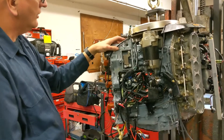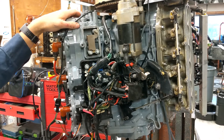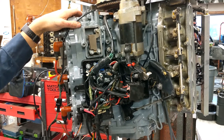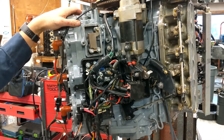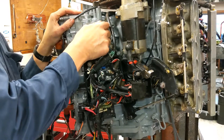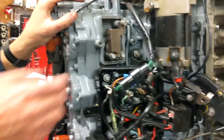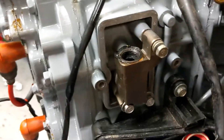These particular motors — the 150, 200, 225, 250, the OX66 — are one of the only two-strokes I know of that has an O2 sensor. It's a very unique thing. It's housed in this housing, and we've removed it — the O2 sensor is actually over here.